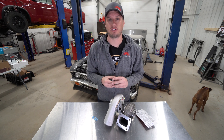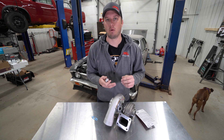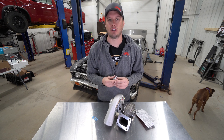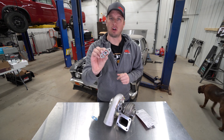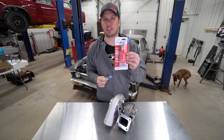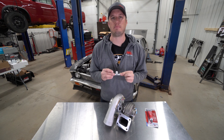And also a bunch of other things like sensor failure, putting oil in the intake — you don't want oil on a wideband O2 in your downpipe and everything else in between. Plus it looks like you're driving Uncle Buck's station wagon around. So what you can do is use this O-ring style oil drain, or make sure you have plenty of gaskets on hand. Don't use RTV.